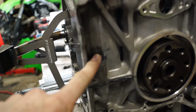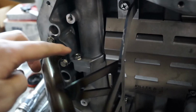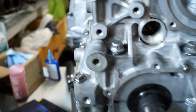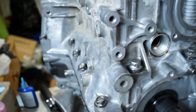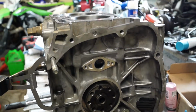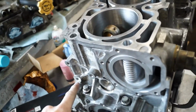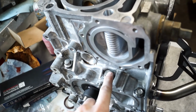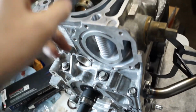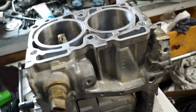After you tighten up the case bolts and stuff, there's actually a couple more hidden ones. There's one here. There's one here. And then all these down the side here. If you get the manual for this engine, then it's actually pretty easy to follow along. One note on this engine, these two don't get the 90 degree torque turn. These are torqued to I think 30 foot-pounds or 38 foot-pounds or something after you do the 90 on the rest of it. So that kind of threw me off when it told me to do that in the manual,